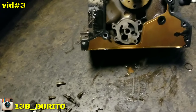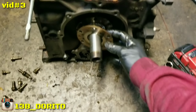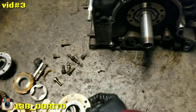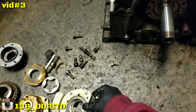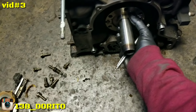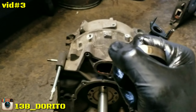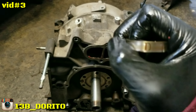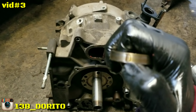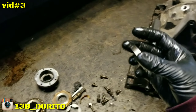Let me bring the engine down. When I bring it down, this thing comes off. Using the magnet for the next needle bearing. The spacer is still there — it comes off. You're going to have different sizes. This little one is the one that's going to prevent your engine from being tight or loose. This is the one we have right now — it's letter D. We're going to save this one because we always need it.